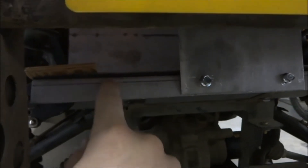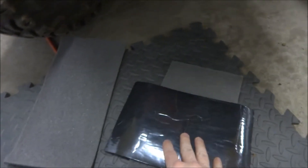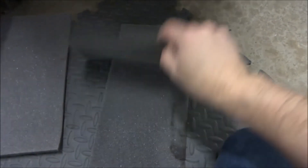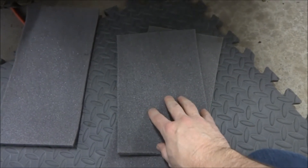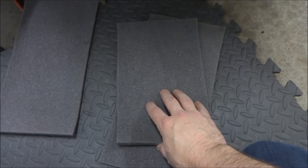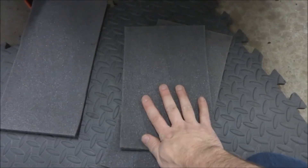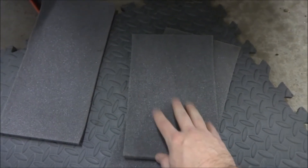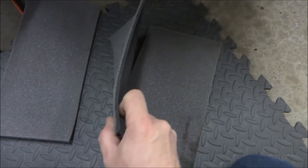Here you've got a piece of wood which is clamping down on a foam material. It's rubber on the backing but foam on the front. Since my lithium-ion batteries are a little more fragile than the lead that was originally in this vehicle, this will be much gentler on the batteries. I'll put that underneath every single battery.